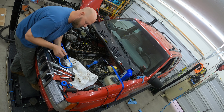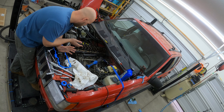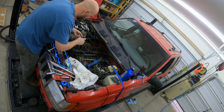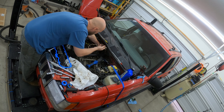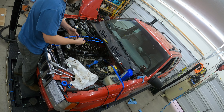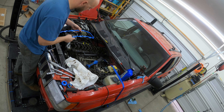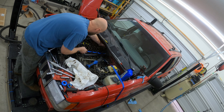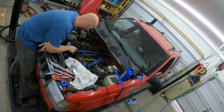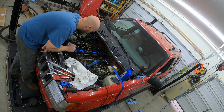I ordered two types of gaskets. Originally I ordered the Felpro gasket when I was planning on just doing the valve cover to seal up the leaks. Then I decided to do the head gasket and ordered a kit that came with a cork gasket — this cork gasket looks like a pain. So we're going to use the actual valve cover gasket I ordered instead, because it's nicer and easier to use. With this one, the bolts actually go into the gasket, which holds it in place. With the cork, you risk pushing the gasket in as you're tightening down.